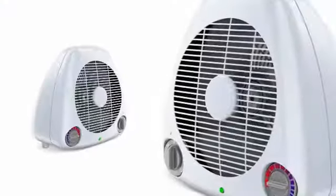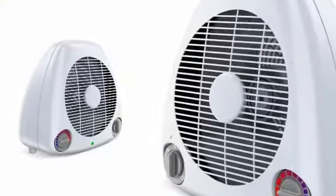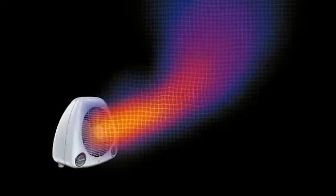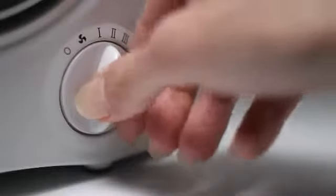Conventional heaters are a bit frustrating. For a start, they emit a burnt dust smell because dust gathers on the heating element. They don't project very well into the room, so you get a very uneven temperature. You get localized heat, but in the further corners of the room, it's very cold. And finally, they have very clunky controls. You have maybe 3 speed settings, but what you don't have is an accurate temperature setting for the room. The air multiplier aims to change all that.